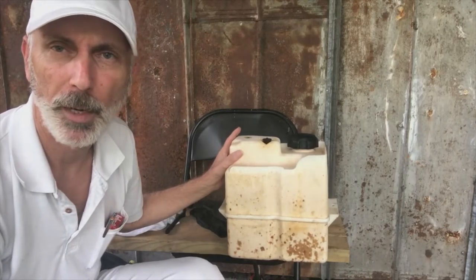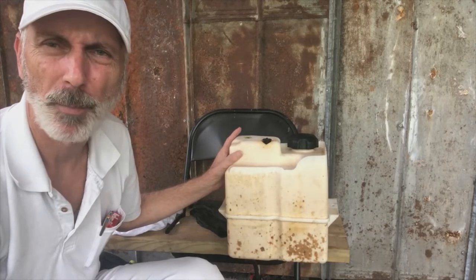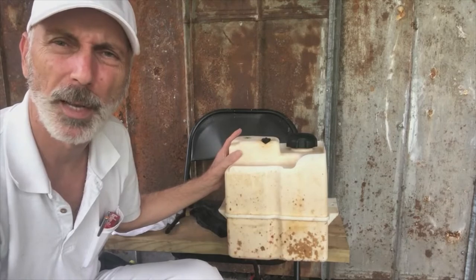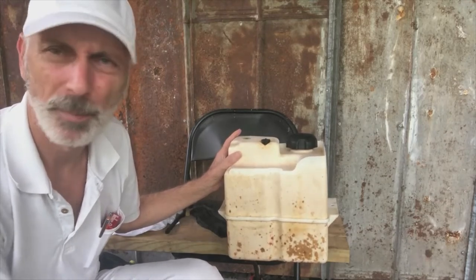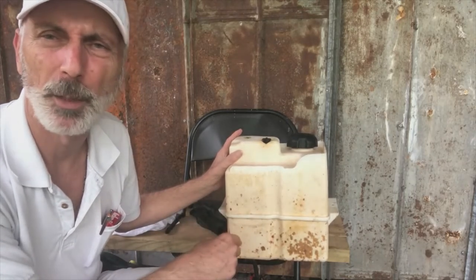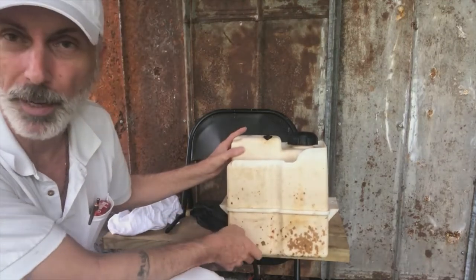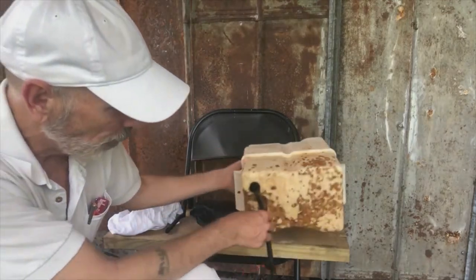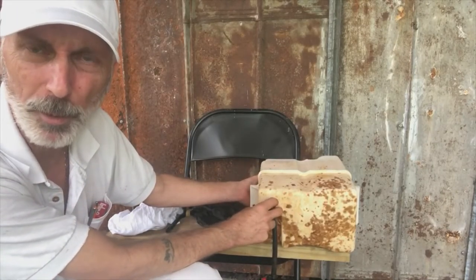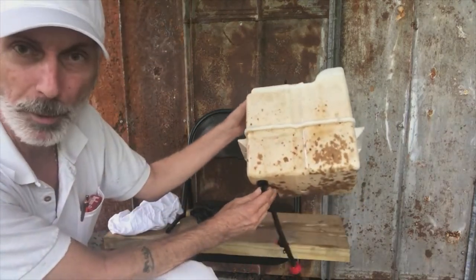I was working on my Craftsman riding mower and replaced a carburetor on it and a wiring harness that got chewed up by a mouse, and you can look for my links on that. But I got it all back together. I had to remove the gas tank and put some gas in it, and it was pouring out. I guess because I messed with it and let the tank be dry because I had to drain it for a while. But this is right where it was leaking, right at the bottom running down, and the first thought was my carburetor, or the hose, but right out of this grommet right here.